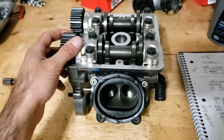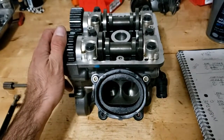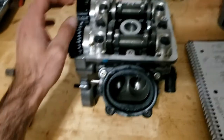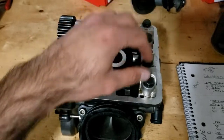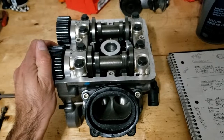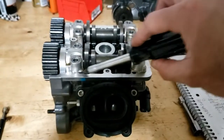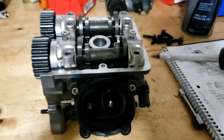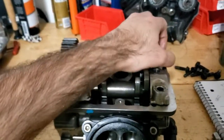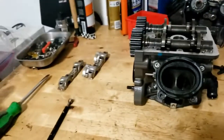We found that the vertical intake left opener shim needs to be changed because that clearance is too small. If you need to change the shim, you need to remove the camshafts. These eight bolts will have to come off using a 12 millimeter socket. Once these bolts have been undone, you can use a small screwdriver to pop those guys off — just yank them off.